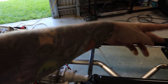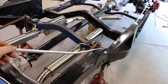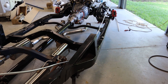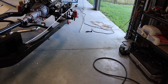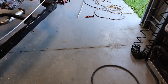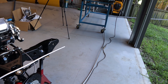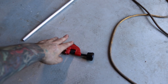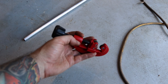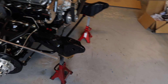With this dash 8 alloy tube, I've just rolled it all out - it comes in an 8 metre length roll. The best way to roll it out is just put your foot on the end and work your way along the ground and it just rolls out straight. I've cut it in half using one of these tube cutters from a flaring tool kit - that's come in handy. Now that it's cut in half it's a lot easier to work with.